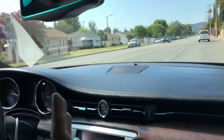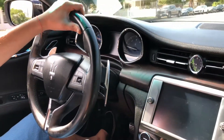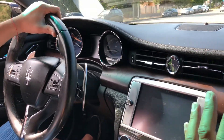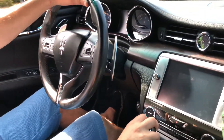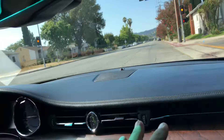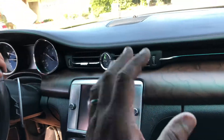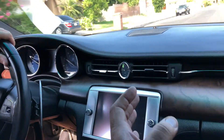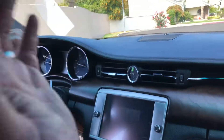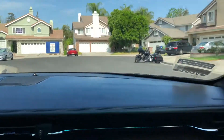We drove about three to four miles. The vehicle accelerates well. When we applied the brakes, there was no shimmy or shaking in the steering wheel. When I drove it, the steering wheel was straight when I released my hands. Didn't feel any pulsation from the brake pads. Shifting was seamless. We drove it aggressively and it performed well. I checked the windshield wipers and all functions — phone connection, heated seats, AC and heater all work. Remote start and engine start work as well. All lights have checked out, rear view camera and PDC sensors too. We're wrapping up the inspection now.